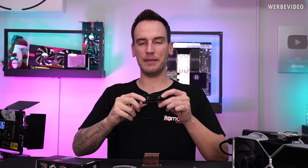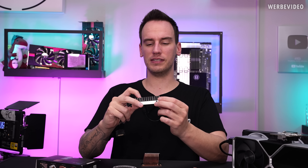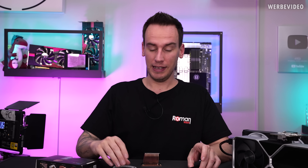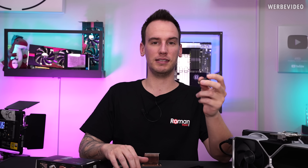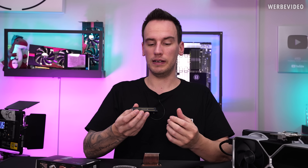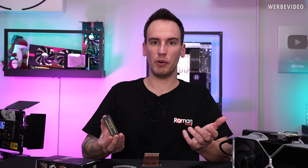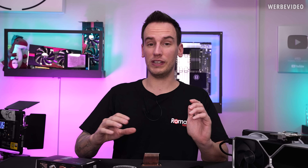To summarize: the GeoShark M.2 5 was actually not too bad — it looks decent, cools well, but has an annoying high-pitched fan noise from the tiny fast-spinning fans. Then we have Final Cool, which is everything but cool — it's probably even heating your SSD. It may only consume one to three watts, and the integrated controller is a nice touch, so if you have a low-power Gen 2 NVMe SSD you could put it on there just for looks. But keep in mind it could actually heat up your SSD due to the LED power consumption.